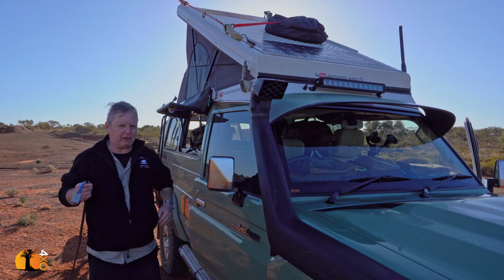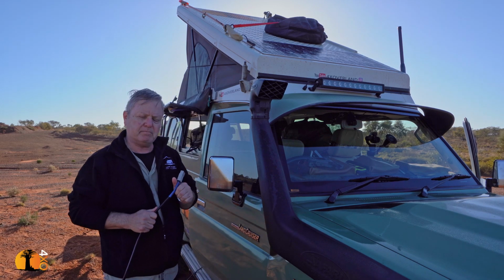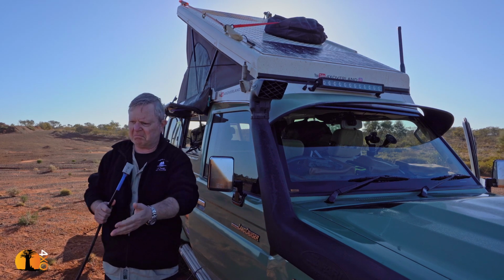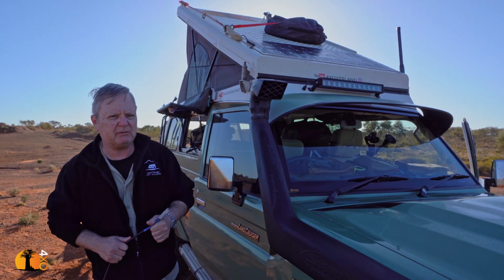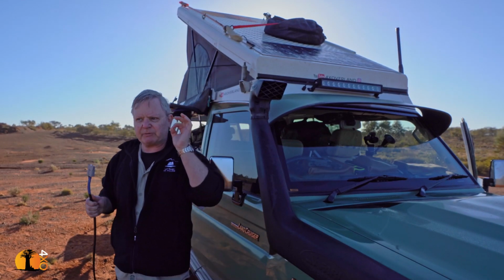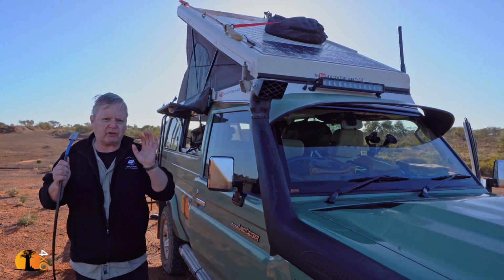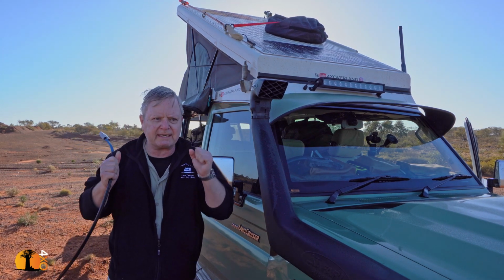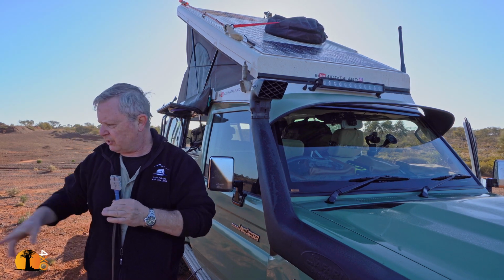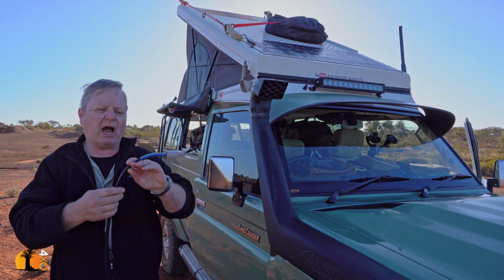A brief word about cables and extensions for solar power. I have seen many times solar experts that will come into your home and say, well, it's only going to produce 10 amps. You don't need a thick cable. They're wrong. They're absolutely fundamentally wrong, because, and I'm sure there's a scientific reason for it, and I don't know what that reason is, but photovoltaic cells are incredibly sensitive to voltage drop. Remarkably so.